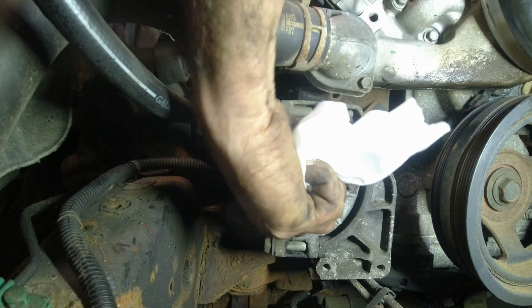Oh, looks good. The belt's spinning, plus the stationary part over here. Alright, we'll turn the AC on. There she goes. Engine's revving up. There it is. Spinning. Nice. Alright, I got a probe stuck in the vent. Watching it drop, we should get to the 40s.